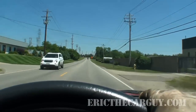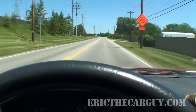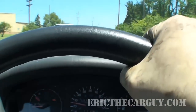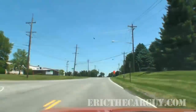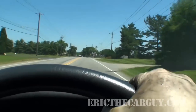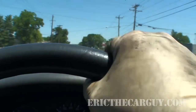This is actually a fairly deserted road with nobody behind me. I'm just going to step on the brakes and confirm that I have a pulsation. I'm feeling it quite a bit in the steering wheel. Let me try this again — once again checking the rear view mirror. Quite a bit of pulsation coming from the front.